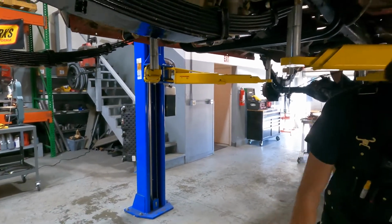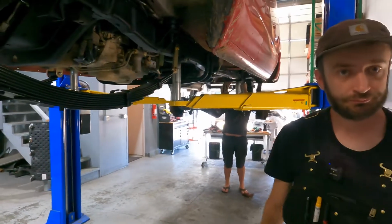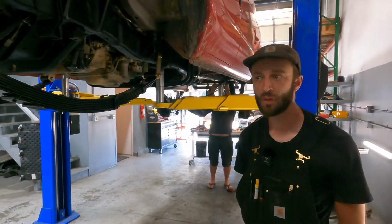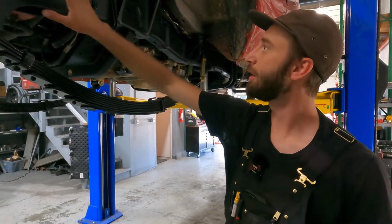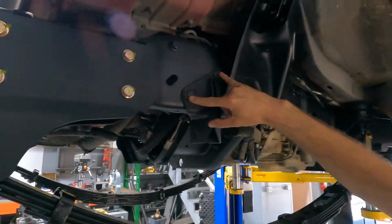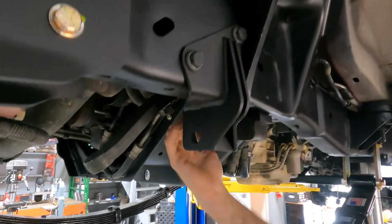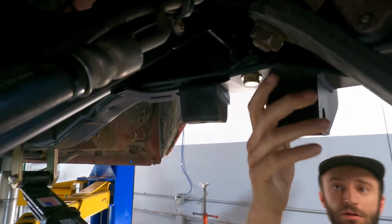While we're underneath here, any other changes in the particular van we're doing today, that E350, that you have to do underneath? Really, the only other thing, you can see these are all our proprietary brackets here. We manufacture this. This is your track bar bracket. It picks up two factory steering gearbox bolts, and then it picks up what was a rivet hole from the factory. So we take that rivet out and then we bolt through here.